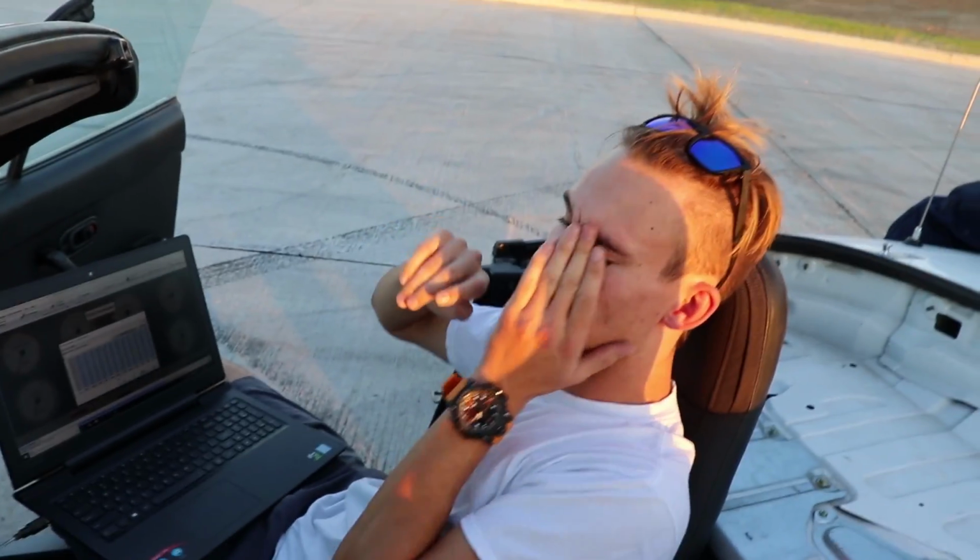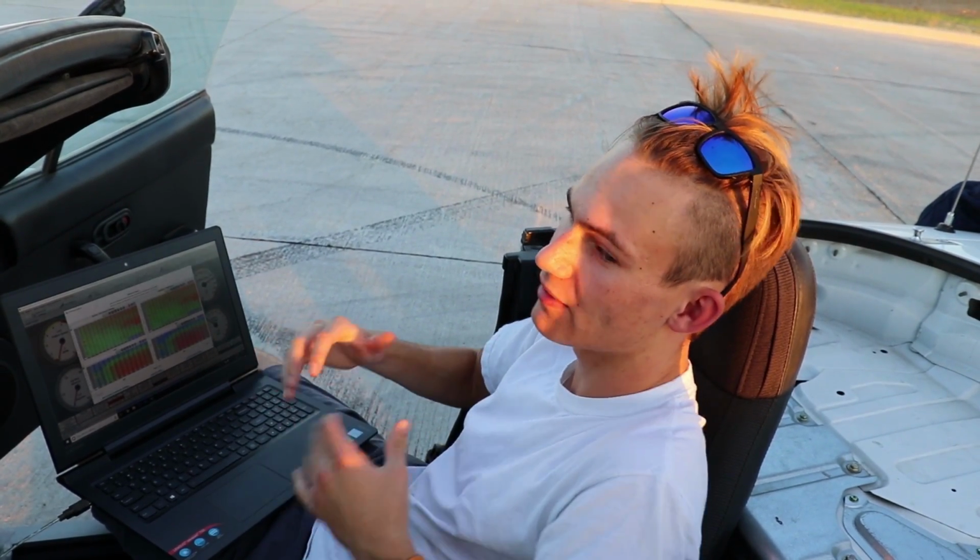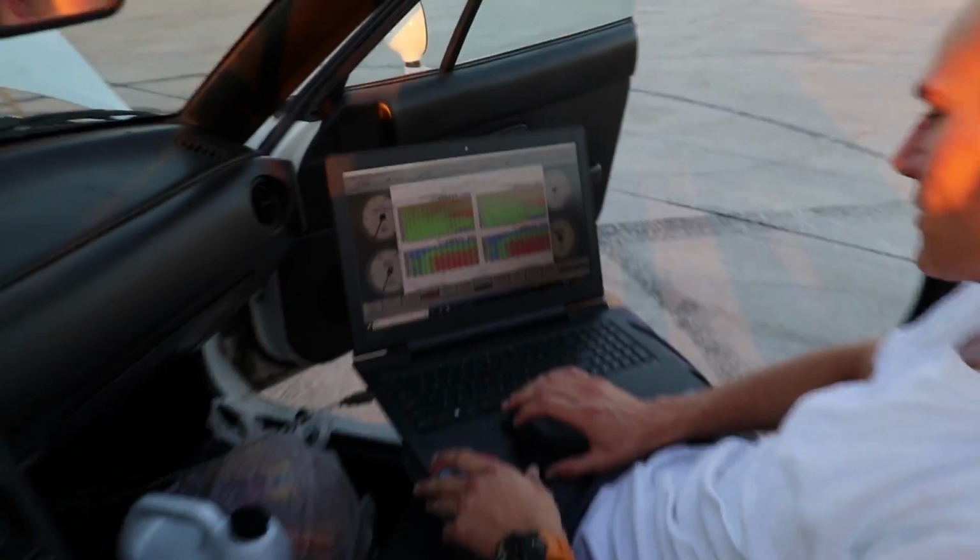Also, it's probably a good thing to note, the timing table I have right now is pretty aggressive. It's almost maxed out as far as power goes. That's no reason for retarding it. We're running something as a fuel that isn't designed solely as a fuel, so we're doing this for you guys.